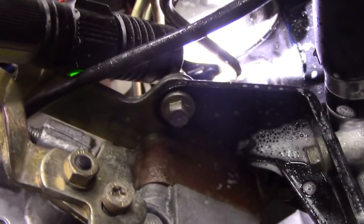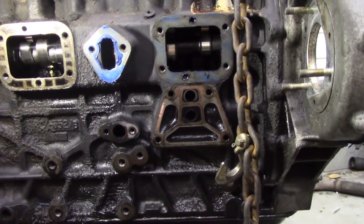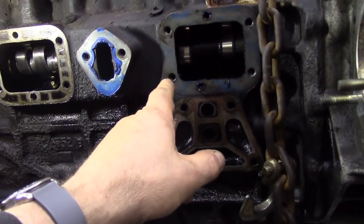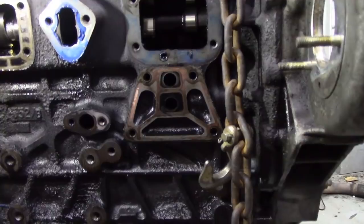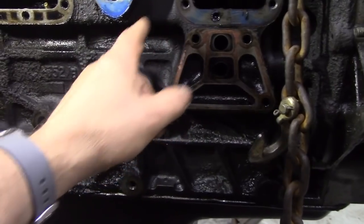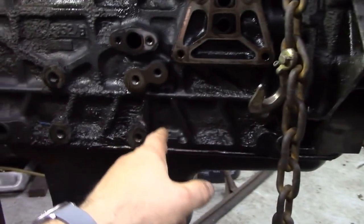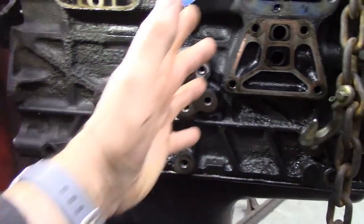Let me get a lift pump and I'll explain. Now, this is the old engine, and we did notice on this motor when we took it apart, there's an awful lot of oil coming down this way. Can you see it? See, it's all greasy and oily, but nothing at this side. Now, we knew that the O-ring on the oil filter adapter was leaking, but you see there, look, you can sort of see where it's been coming down. So that's been leaking for quite a long time. This has been leaking and dripping down here, but notice where there's a distinct border here, there's nothing. It's sort of semi-dry, but all that's there and all that's there.